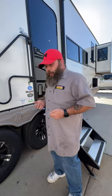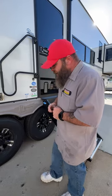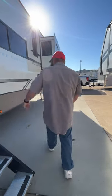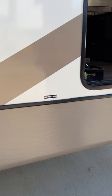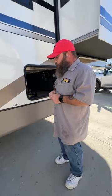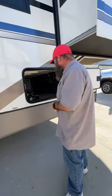I like to say that when you leave a campground, the first stop is usually the gas station — check the lug nuts while you're filling up and you're knocking out two birds with one stone. Keep your tire pressure topped off to the max PSI, which on these tires is 80 PSI — Goodyear puts it in big letters on the sidewall so you don't need a magnifying glass. Over here you've got a sticker labeled 'low points' for the lowest water line points in the coach. Open those when winterizing, open the faucets, get as much water out as you can, winterize, then open them back up to release pressure. I also recommend opening these lines and a faucet on the way home from camping — air will blow through and push out any excess water so it doesn't become stagnant.